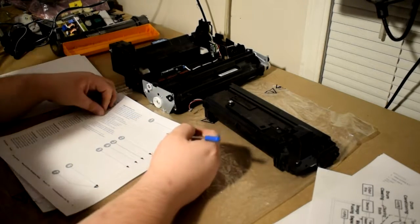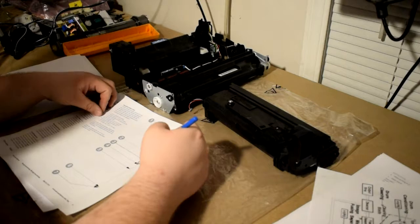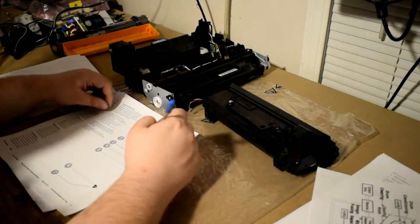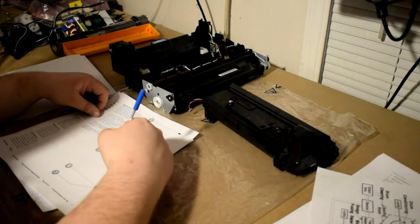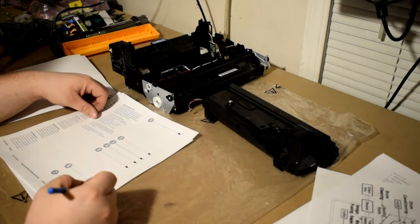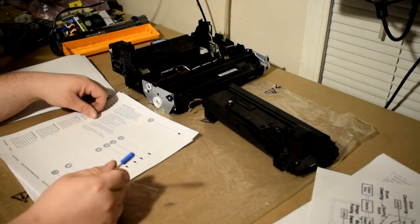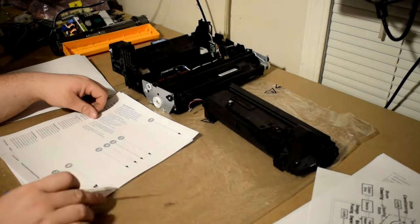I like how it keeps coming with print cartridge, because 2, 4, and 5 are print cartridges. They're saying 3 is a transfer roller issue, because transfer rollers are typically smaller. 5 is print cartridge, 6 is a fuser, 7 is a print cartridge. When you get into issues like this, where 6 and 7 are next to each other, this is the fuser, that's the print cartridge. So imaging drum, fuser. This is when you take the two out and just look at them. Typically you can find the defect on the roller.